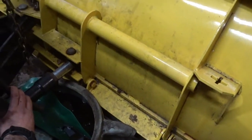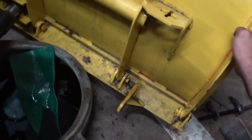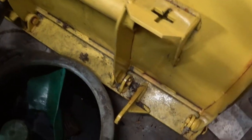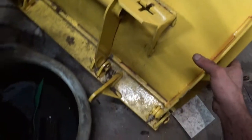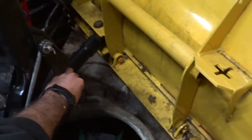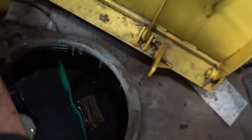The reason I strapped it down is I can't really move the plow blade without the whole thing moving on me. All we're doing is pushing this inward to get the fluid out of there. Then we're going to move on to the other hose and push it the opposite direction to drain that side as well.